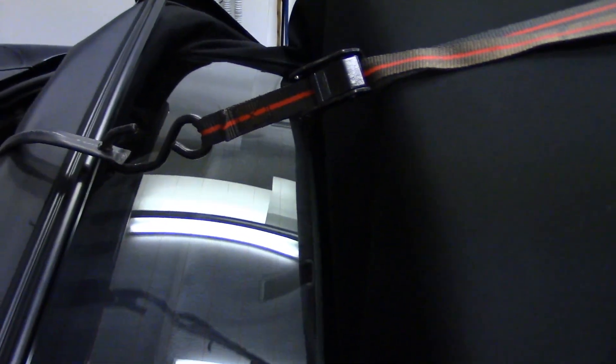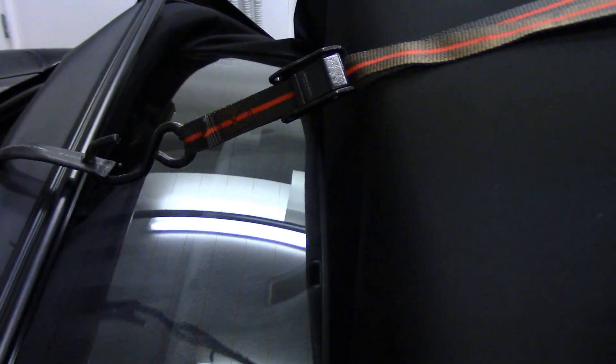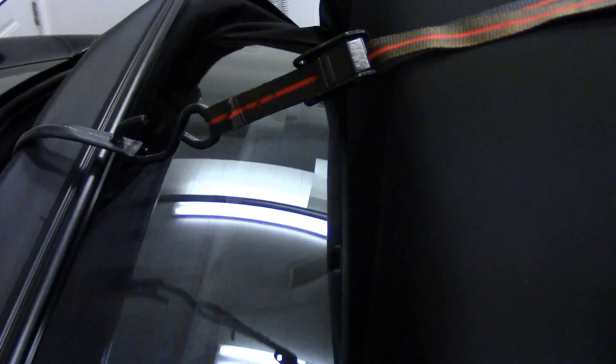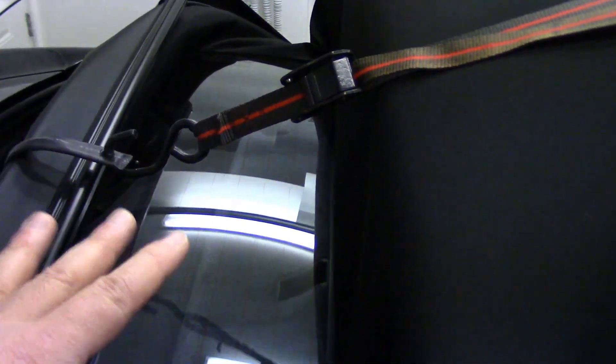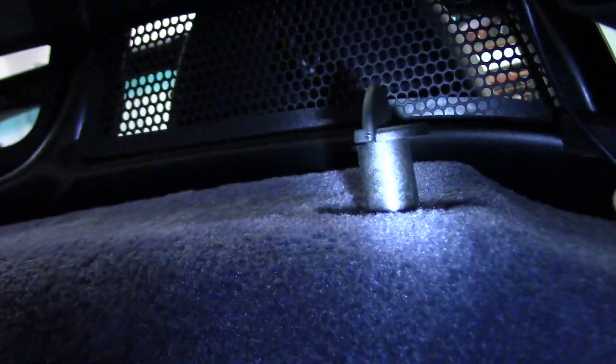This is only if you have an aftermarket glass top that doesn't fold all the way back. If you've got a later model 986 with the glass window that has a different mechanism, it will fold right back. And of course, if you've got the vinyl window, it will also fold back — you don't have to worry about any of this. So we've just got to get the top cubby box off now. It's really simple — there's just these two little screw buttons on each side. You just turn it a quarter turn and then pull it up, and then this will lift right off.